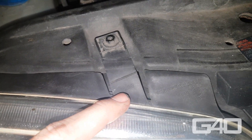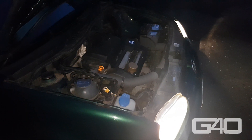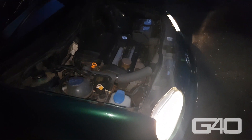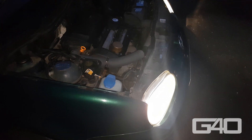If your headlights are manufactured by Valeo, this would be great, because the part of the headlight you need to remove is screwed. On Hella headlights this is one piece, so you need a Dremel or anything like that to remove it. Make sure your build is road legal — for example, in some European countries this is not.